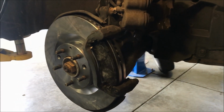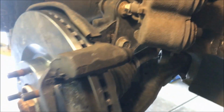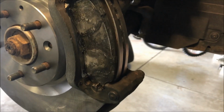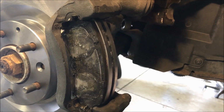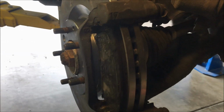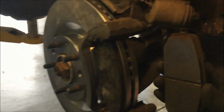So we got the new one on, we got the bracket remounted, and I've actually already greased those areas that we had talked about with that silicone grease lubricant, and one of the pads is set in there into the grooves in the bracket, and that brake pad actually looks terrible, but we're gonna keep running. I cleaned it off a little bit, the surfaces that touch the caliper, and then greased it. And then here is the back side. It's going to be going in.